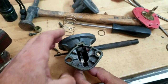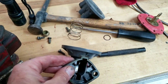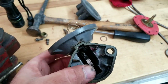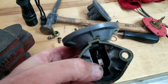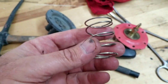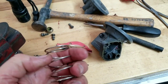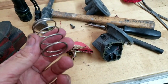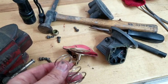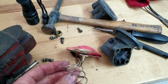This is your 36 horsepower fuel pump. My pin pushed out, this all came apart, and I could not tell how it went together. But this is how it goes from what I can tell - with the spring in place, you have to twist this thing on. If you're rebuilding one of these, like I said, this is a pretty hard job to do. I'm pretty good at this stuff and this is one of the hardest things I've ever done on a VW.